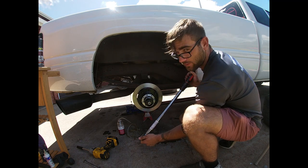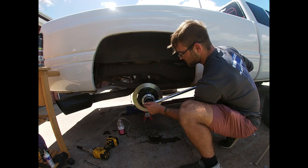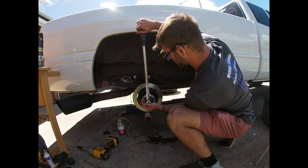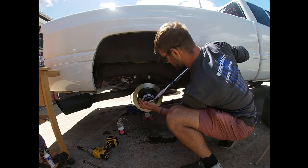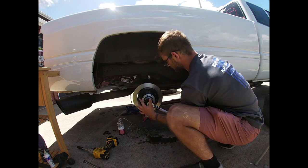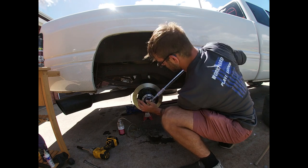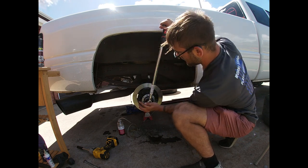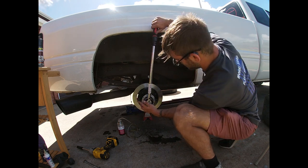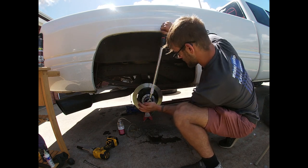Alright, so I have it set up this way, that way you guys can see what the angle looks like and how I show or justify my one third of a turn. I'm gonna go ahead and torque it down. This might take a second because you can get it hand tight, but for that nylon portion there for the lock nut, obviously it's too tough to do it by hand, or at least it is for me. Maybe some of you guys can do that, I don't know.